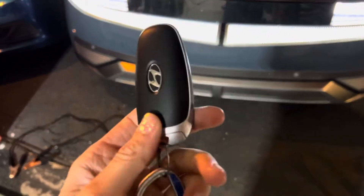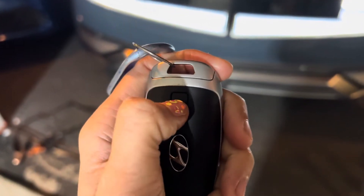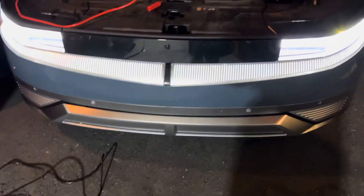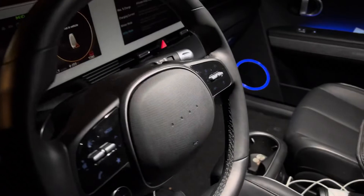To get in, you take your key fob and push on it — the manual key will pop out. Use that manual key to open the door. Once it's open, you push the key outlet in manually. Your car will be dead, so go ahead and open up the hood by pressing on the release right here.